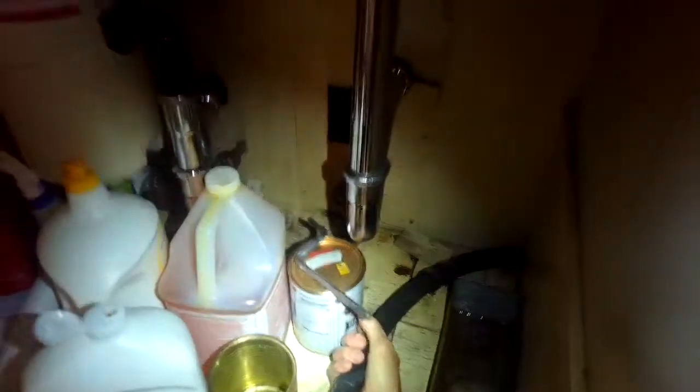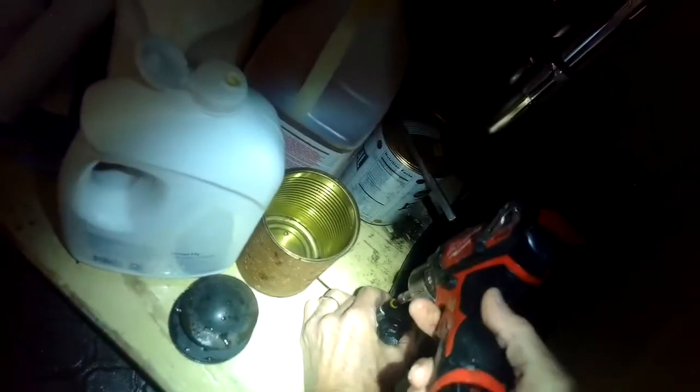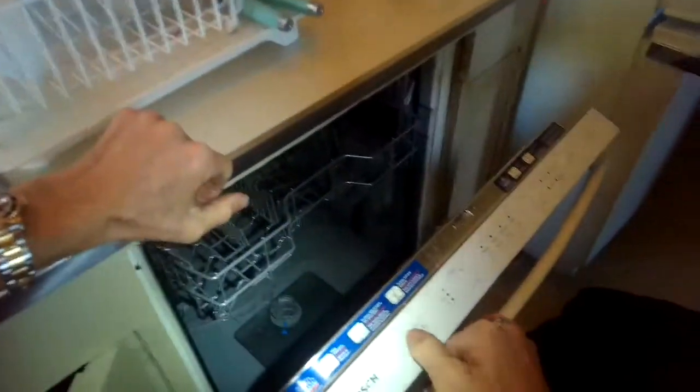I'm going to put it back together, so I'll put that tube back in. I actually don't recommend having a drain tube set up like this one — they just didn't have the right drain tube so they kind of Mickey-Moused one together, and these tend to get clogged. I would just use the standard one that comes with the dishwasher. I'm going to put the hose back on the garbage disposal and get it nice and tight. Then I want to bend that hose up in a big arch that goes way up as high as the sink — that way water won't flood the sink and then flood the garbage disposal and flow backwards into the dishwasher.